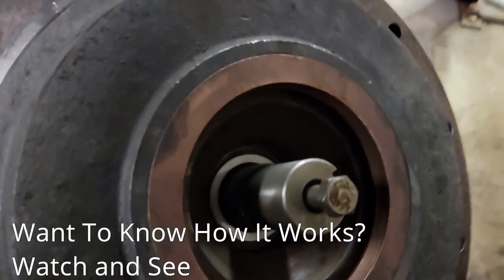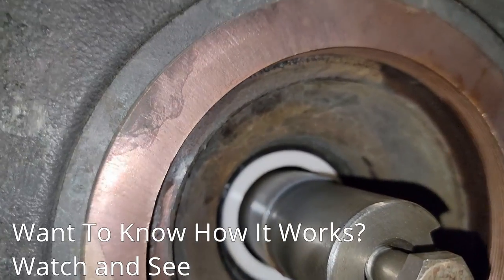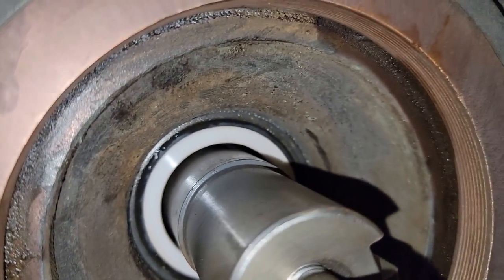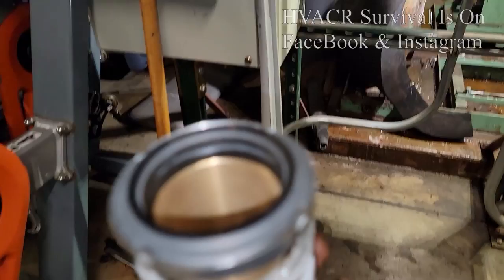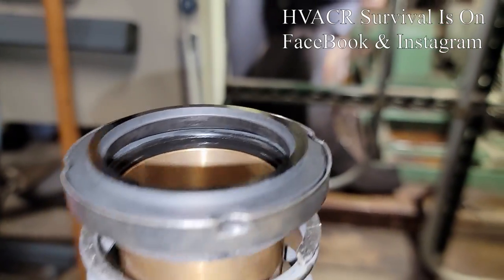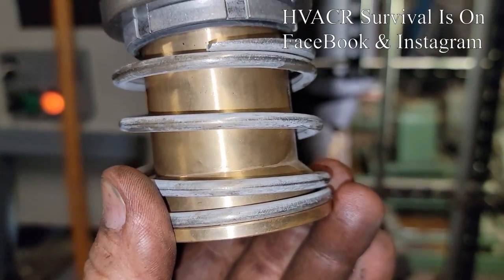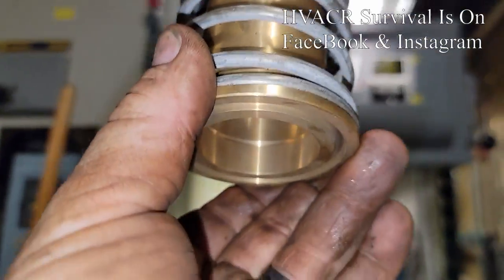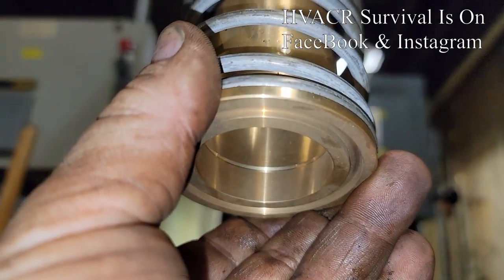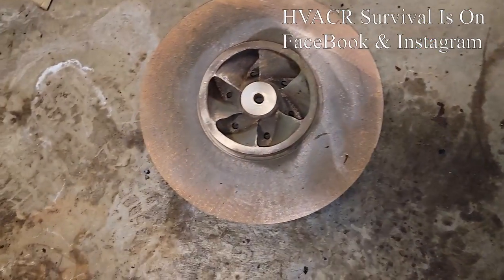We're going to explain how this thing works. You've got the ceramic piece there encased in rubber — the rubber's got a tight seal against the metal. You've got this piece here which is your black ceramic encased in rubber; the rubber touches the brass, it's going to slide down onto this brass. The spring's going to put pressure against it, and then on the back side here you've got an o-ring that goes between the brass and that cut mark there.